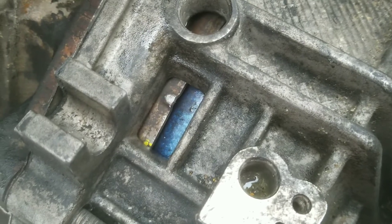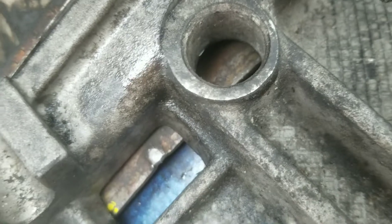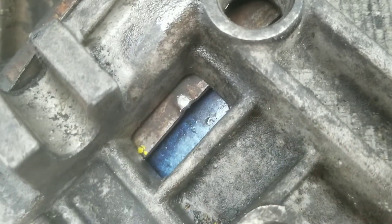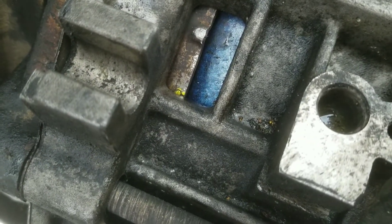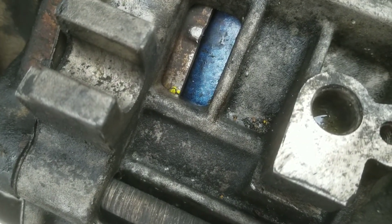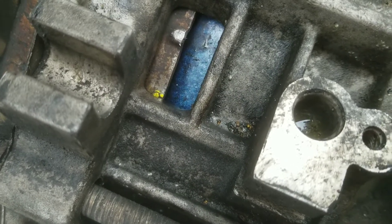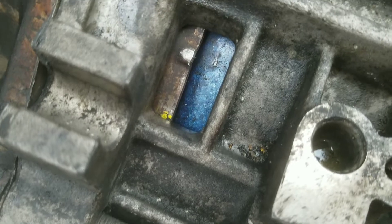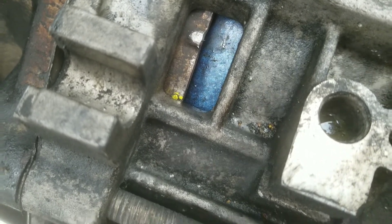On a manual trans, as I recall, there's a little pointer inside — I think there's only one hole in the manual trans, don't quote me on that. There's a little pointer that sticks down in a round type hole and points to the flywheel for top dead center, as long as you don't have an aftermarket flywheel. But on the automatic — 2002, so I'm guessing 99 to 04 and a half or so, ALH type engine anyway — that's where top dead center is.